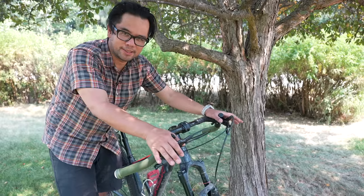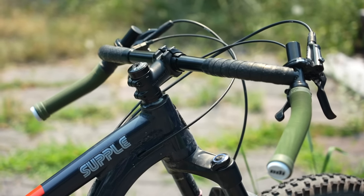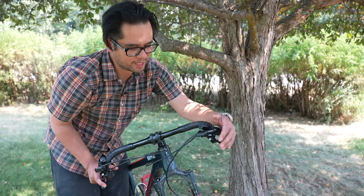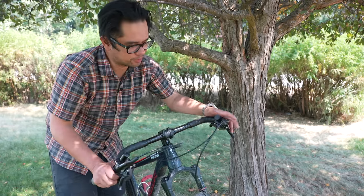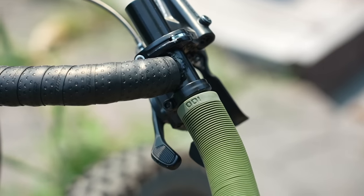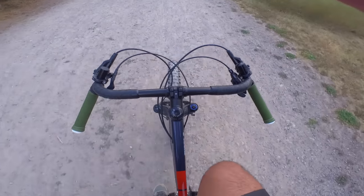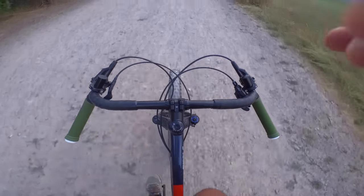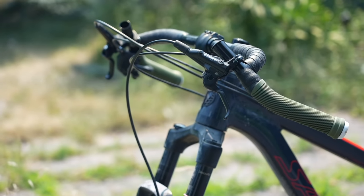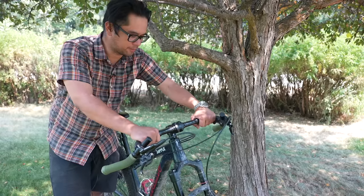You do lose the in-the-hoods position, so what I found is that I had to raise the handlebar a little higher — kind of similar to how you would set up a dirt drop. On the left I've got a combined brake and dropper lever. I do think things would fit a little bit better if you could split it apart like I have on the right side. In terms of tape, I'm trying out these ODI grips which are slightly easier to put on than ESI grips. They have an interesting slinky-type rubbery feel, and I've got some Jaguar Pro handlebar tape — using half a roll I was able to cover the flat part for the tops of the bar.